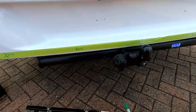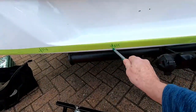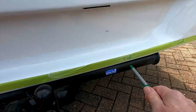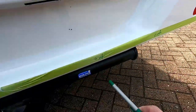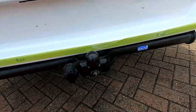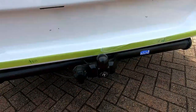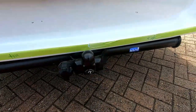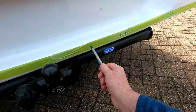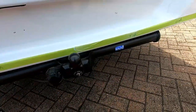So I've put some masking tape on. I found the center line. I've marked out 35 centimetres, and 35 from that one to that one, and the same there to that one - this is 30 to 40 centimetres. I've decided that 35 would be quite adequate and cover the area that I need at the back. So the next job is to drill the first hole, but first I'm going to have a look underneath just to make sure there's no wires running behind here, because obviously you don't want to cut into anything.